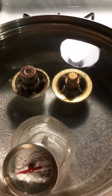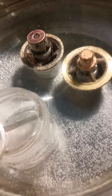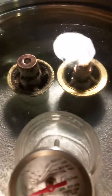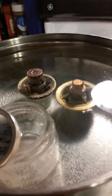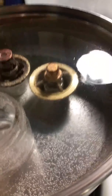I filled up the pot with a little more water so it's submerged again. The temperature is at 155 or so. The 145-degree thermostat has definitely opened up quite a bit, although it's harder to see now because of the higher water level. The 160-degree thermostat has not opened at all yet. If you look very closely, you can see the lip on the 145 thermostat is higher than the one on the 160 — it is working.